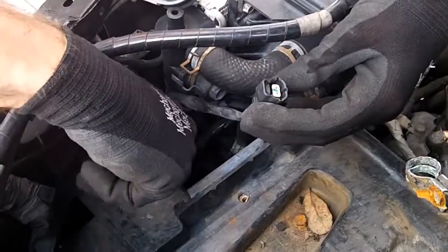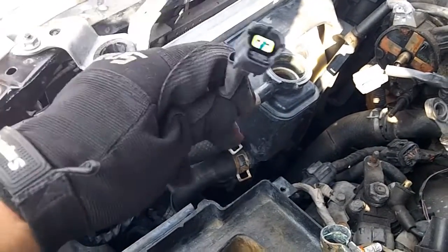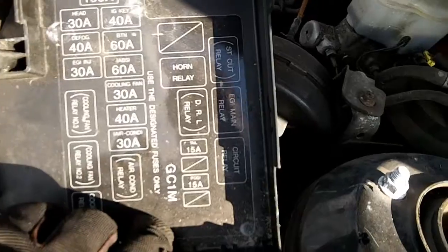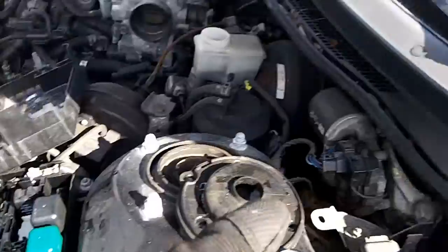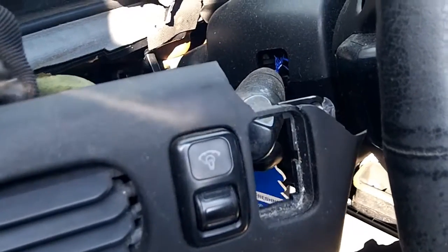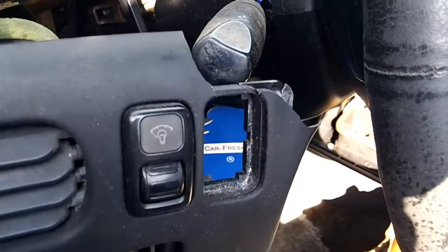Now, if your car does not come with the wiring harness — if your car basically doesn't come with fog lights — remember to get the connector for it. You're going to have to wire it up yourself, but we will have detailed instructions on mazda626.net on how to do that, compliments of Andy. The V6 has a fog light fuse, which should be one of these fuses here. Andy's already pulled out the fog light switch, which would be right there next to the dimmer switch. On I4s, you'll notice that that port is just a blank cover.